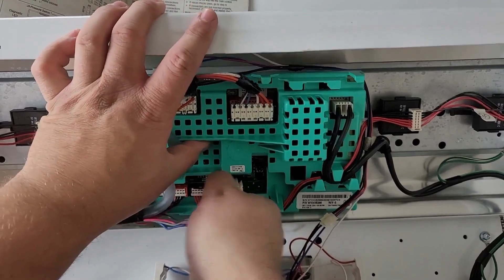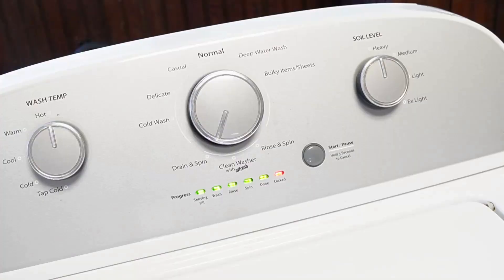During this time, you're going to hear all kinds of noises from the machine, and that's going to be totally normal during the approximate three minutes. When the calibration mode is at the end, every single light is going to turn off, including the lid lock light, and the machine is now ready and recalibrated for use at an optimal level.